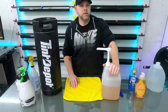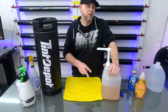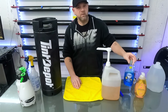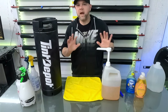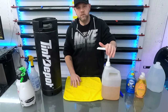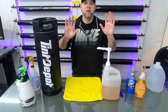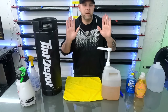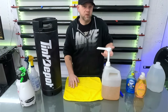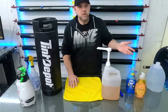The magic formula I use for these films is two ounces of baby shampoo per gallon in warm or hot weather, plus a little Dawn. I haven't measured the Dawn exactly — it helps get the tint to tack a little quicker to the glass instead of staying super slippery. The baby shampoo amount lets you slide the film into place without it tacking up too soon, and the Dawn helps it cling to the glass a little bit quicker.